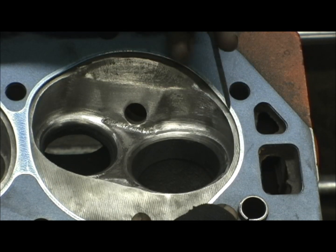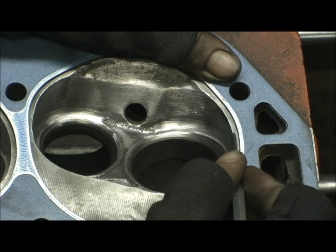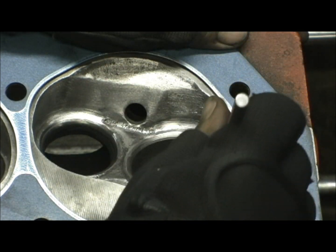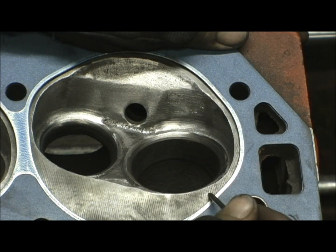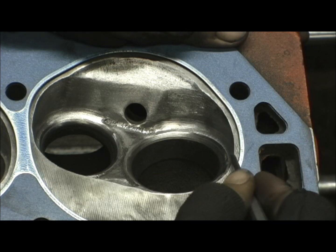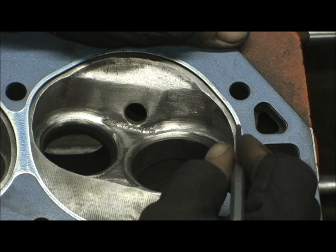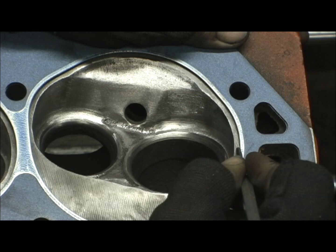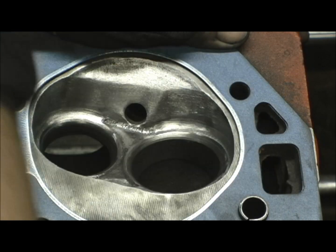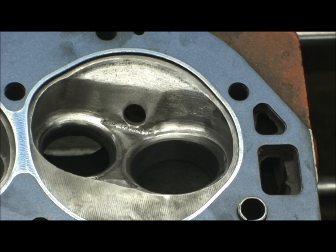What I wanted to show you is the reason I had to do this and couldn't come all the way over. I actually took my template, started here, and moved it over a considerable amount — I'd say probably 150 thousandths. The reason is we don't want this overhang going all the way to the 454's gasket line when the bore of the cylinder is going to be right about where this line is, because then you'd have a serious aerodynamic drag going on.